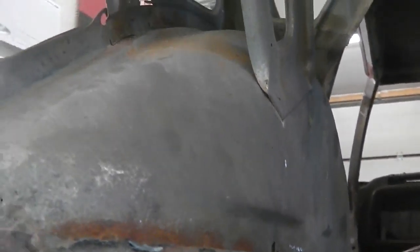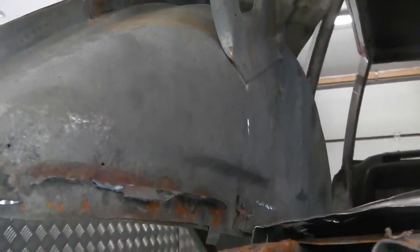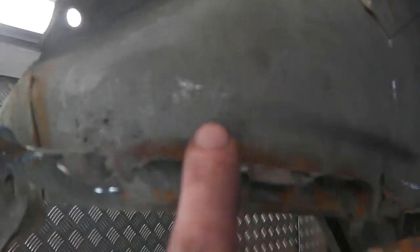And that then would be some pinholes to fix up this end, some little plates to go in. There's enough to salvage there. It's not rotten where it's going to blow back. We'll be able to get that in with the MIG, and a piece of copper bar if we can fit it behind it. If not, we could even braze that. It's in the right kind of place, an area where you can puddle the braze in and sand it back.